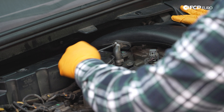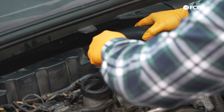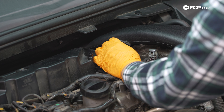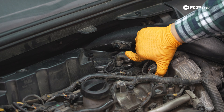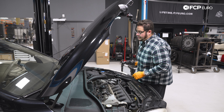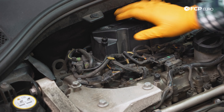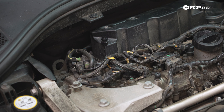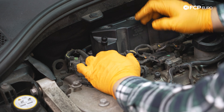This one looks like it was extra tightened down at some point. Once we've undone it enough, the elbow is just going to come off. Right behind it we have an electrical connector — it has one small tab up top, pretty standard. Press it down to release the connector and then pull it off the oil trap, swing it over to the front and tuck it away. Over on the passenger side bank we have a couple of solenoids and vacuum lines just holding onto a tab coming off the oil trap — simply lift it up as one and let it hang off to the side.